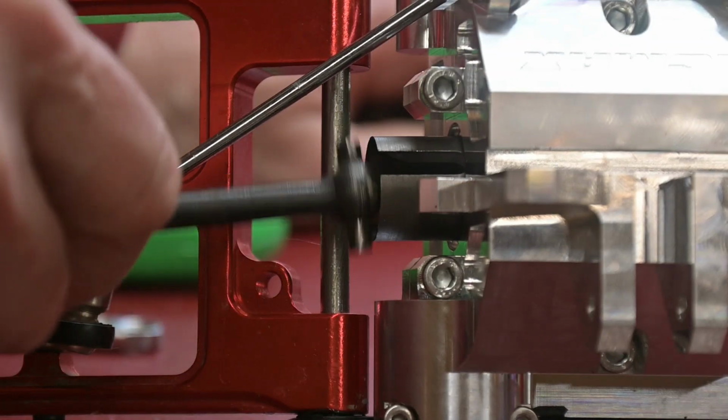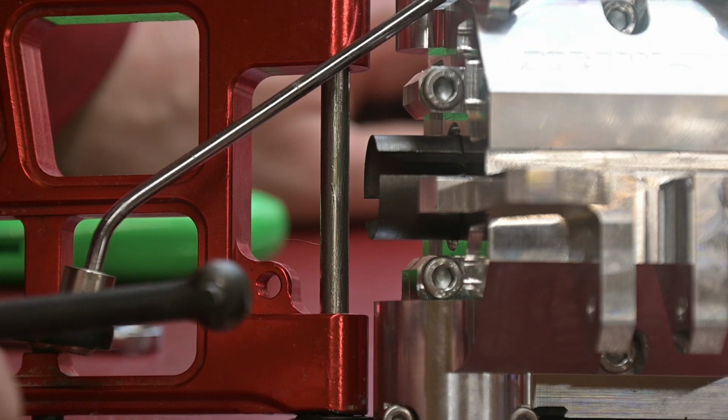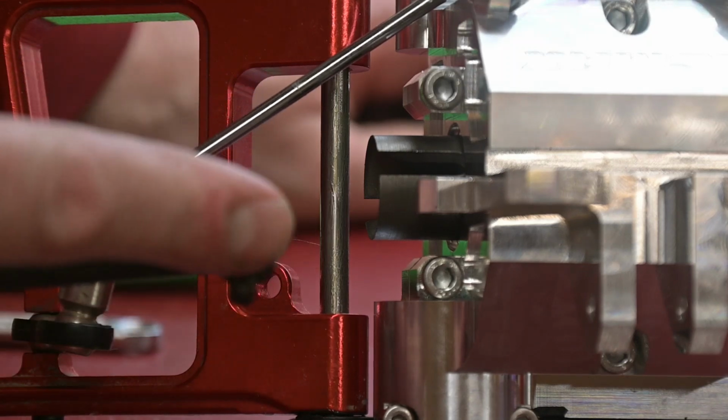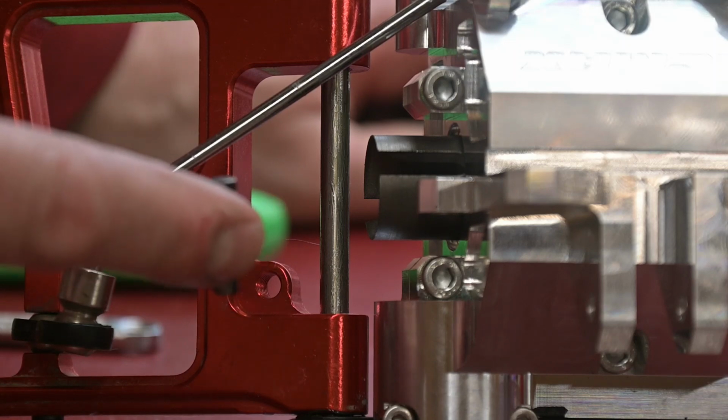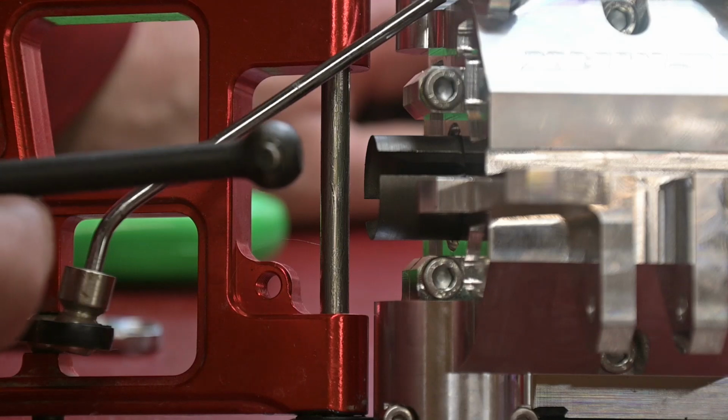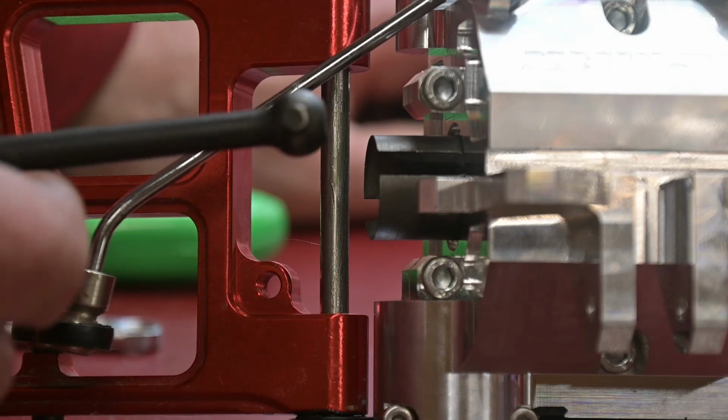This one ain't happening. So I'm going to have to pop these pins off of here, press them out, put these in the lathe, clean these up, get them down till they're clear, and then press in some new D2 5mm drill rod for drive pins.